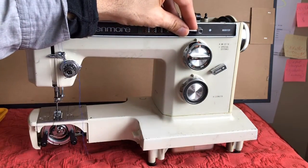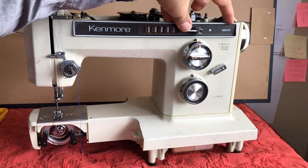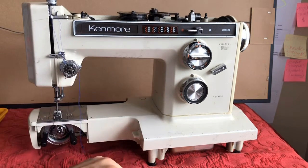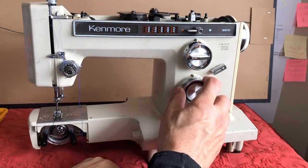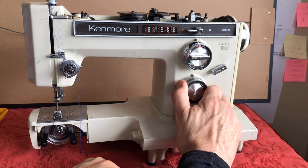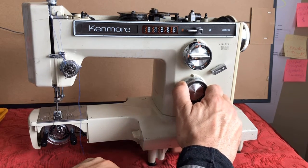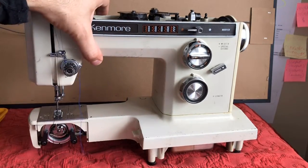You can see the machine was designed for regular stitching as well as a modifier for stretch stitches, but this machine is nowhere ready to try stretch stitches yet — first we've got to get the regular stitching working again. This little controller that controls stitch length, when I try to move it it moves sort of kind of — but it is, like the rest of the machine, still stiff. The good news is putting the WD-40 solvent-based product on here has allowed it to dissolve some of that old grease.